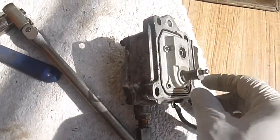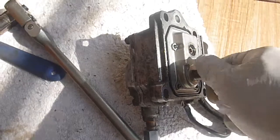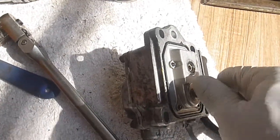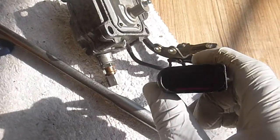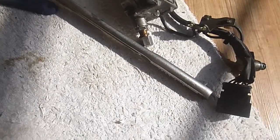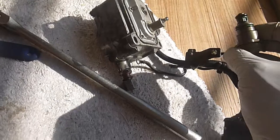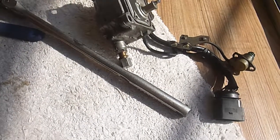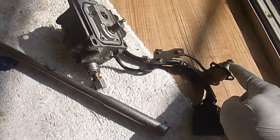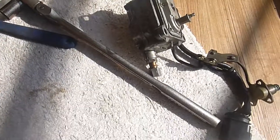The computer controlled quantity adjuster - the injection quantity adjuster. You just want to make sure that this little knob on the bottom has full range. That's full range and it makes that clicking noise - you hear that? That's the springs. There's two springs in there to pull it back. You can look at the pinout here on it. This is a 10-pin because it's 2000 to 2003, I think, that has the 10. The other ones have the eight and the two. The two is for the cold start valve, which goes to the bottom of the pump - it actually puts a little more fuel into the injectors when the car first starts. The computer tells it to turn that on or off. That's in the 10-pin plug, not the 8-pin plug, and that makes it so that you have to take all this apart.